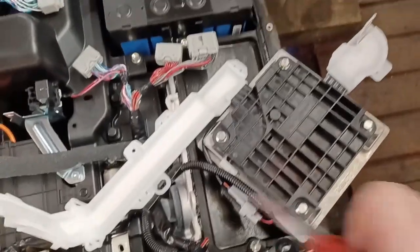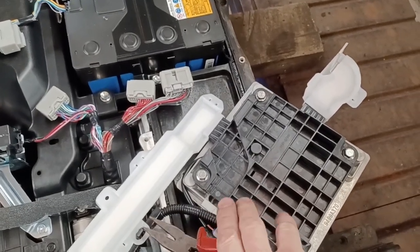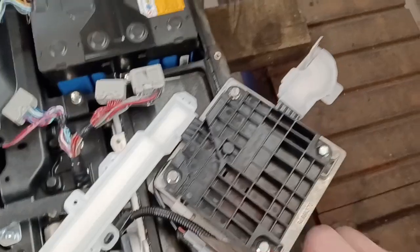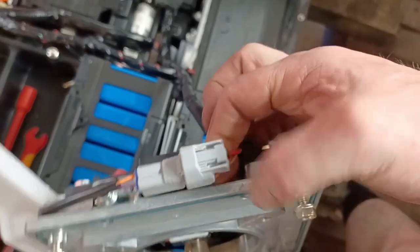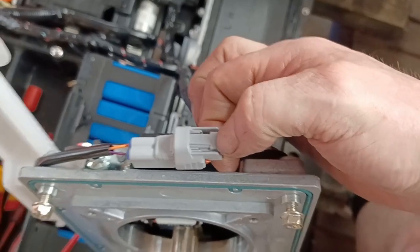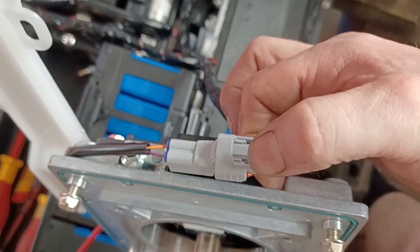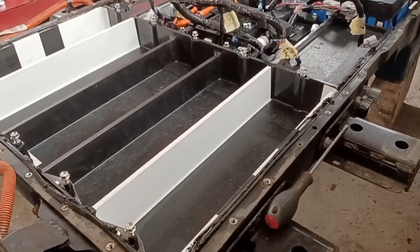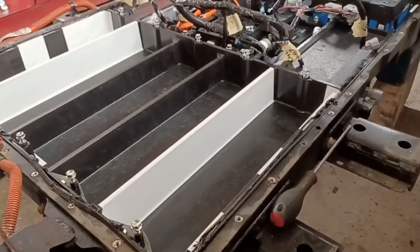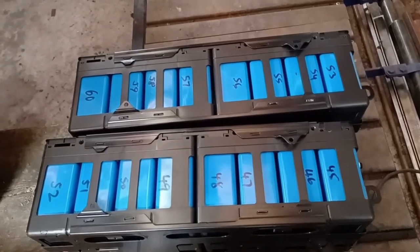So that's the underside. I need to disconnect this here so that that comes undone and disconnect that, then it can be taken away. To disconnect this connector I need to press this tag at the end quite hard — that will allow this assembly to pull off, thus freeing it up. So as you can see, we've now harvested the cells from one end of the battery tray, so the front end is empty and I've just got the individual cell blocks to store and sort out and turn over to the black car.